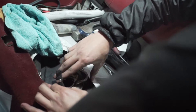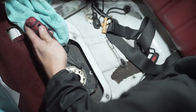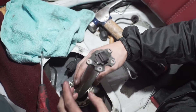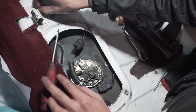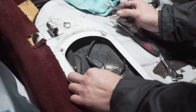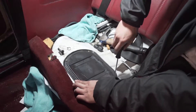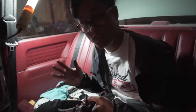We just replaced it with some zip ties that I tightened the hell out of. I wish I had the right hose clamp, but we both agreed this should work - I used some pliers to tighten it even more and it doesn't feel like it's going anywhere. Now I've got to plug in the level sensor, which measures the fuel level. That's it for the fuel pump.